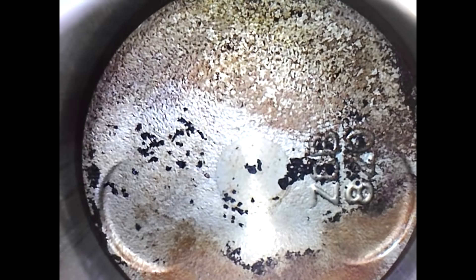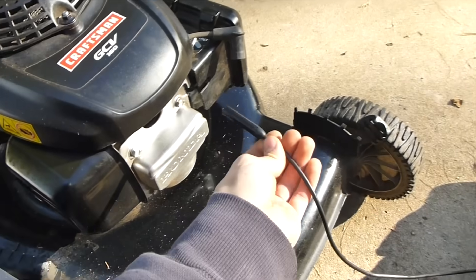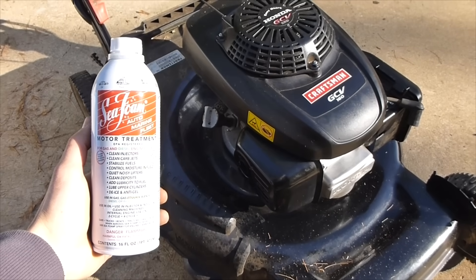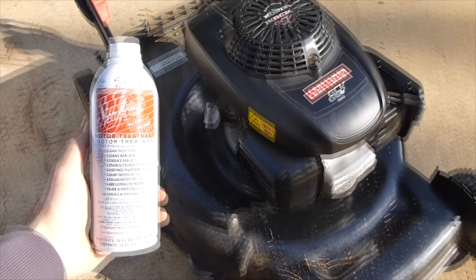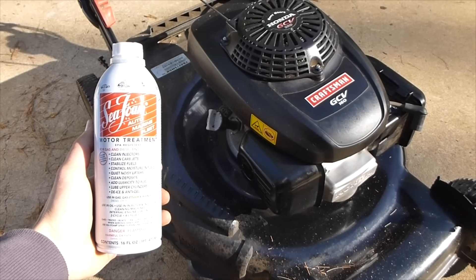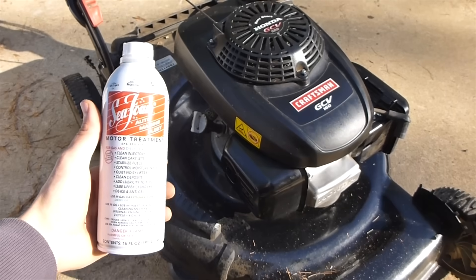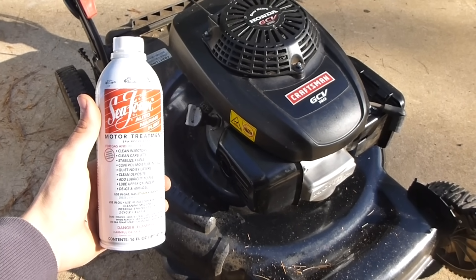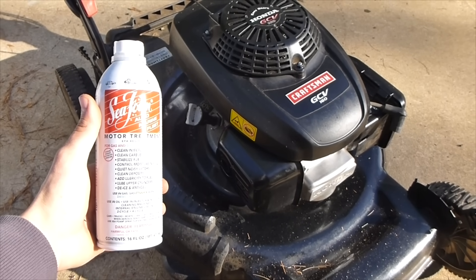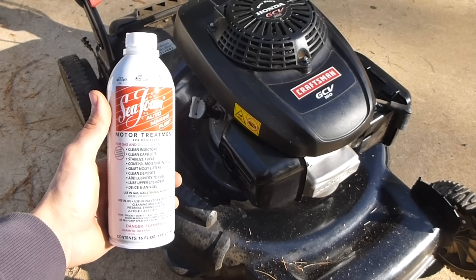Now that being said, in a car engine, would I soak the piston? Unless I have a major problem, no, I wouldn't. And that concludes the test. So does seafoam work? We did the first test the way it's supposed to be done — pouring it in through the intake — and yes, it did work with pretty good results. It got some of that carbon out, and then on the second time, it got a little bit more carbon off the piston head. And then we tried soaking the cylinder head with seafoam, and that got the rest of the carbon off. Seafoam worked good enough for me by running it through the intake. Unless I had so much carbon buildup that it was causing problems with the engine, I'd just use the intake method. I'm really excited to go test this out on a car engine and see how it works in there.